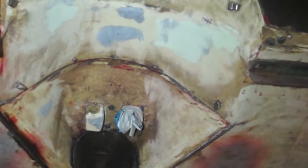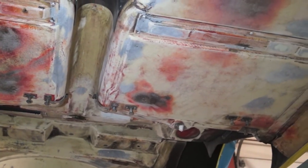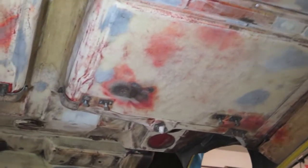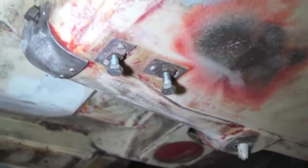After hours and hours of work scrubbing, stripping, and fixing the underside, this is what the original 1956 fiberglass looks like. You can still see signs where some burns were, but we glassed in as many of the holes as we could and repaired as much of the really ugly stuff as possible. To duplicate the original installations, we're keeping all of the seat mounts and seat belt mounts. Any additional racing seat belt mounts we're going to fabricate mounting plates that look very similar to the originals and rivet them to the floor.